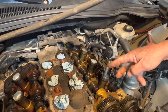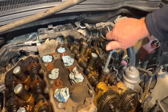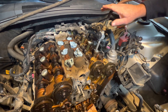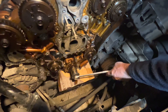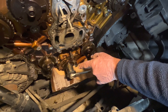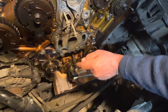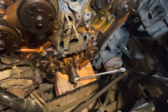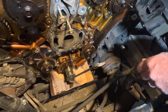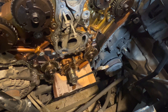I'm fixing to prove that those intake and exhaust valves are not leaking. I've backed off my valve — nothing going in yet, you don't hear any air. I've got a wrench on my crankshaft because the air pressure will push the piston down and move the crankshaft. Now I start applying air — you can hear the air, see the crankshaft move, the wrench came up. I just proved that those valves are holding — it shoved that piston down.